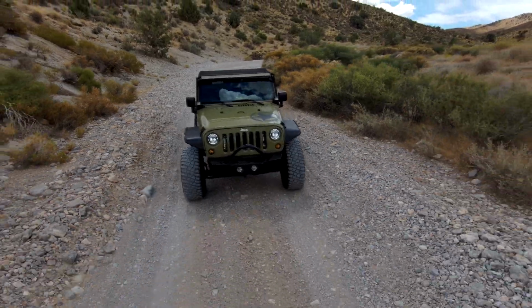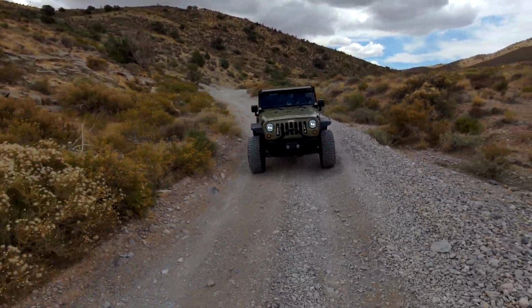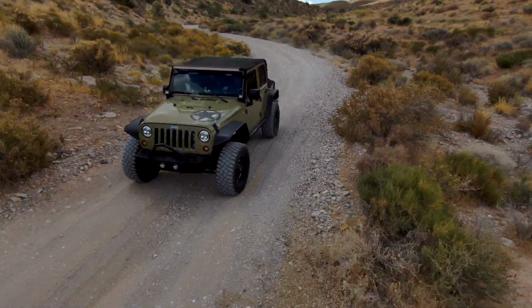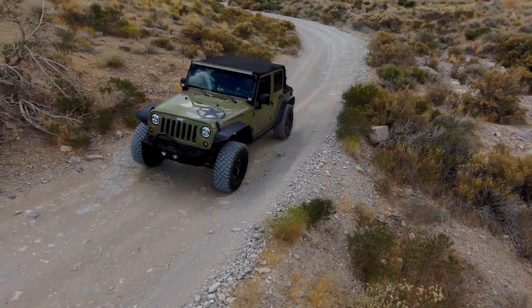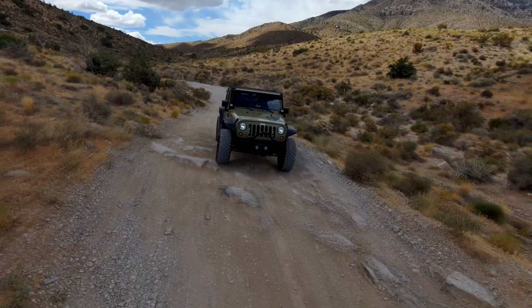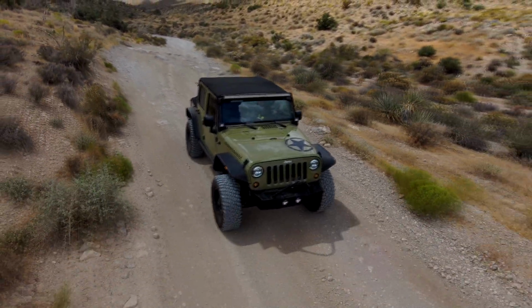But here's the thing, if you turn your AC on, let's say your engine's running at 225, you turn the AC on, now the condenser gets up to 250 PSI, fan turns on, AC pressure comes down, but so does coolant temp. Coolant temp comes down because the radiator's right there with the AC condenser. Our module looks at all those signals, and then it decides the output of the fan.